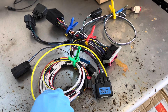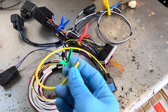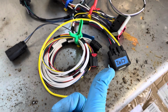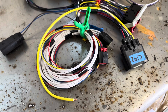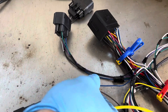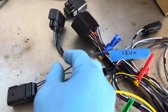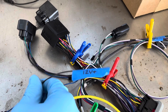You'll notice this big yellow wire — this is the starter feed to the starter solenoid. It's not a big gauge wire, just the trigger for the starter; that's the output from the starter relay on the truck. There's a one-pin connector on the truck that I just can't source — no one can come up with a good answer — so you'll have to splice that in. I'll include directions on that once this is fully released. For tow haul mode, all you need to do is give that wire 12 volts, and it goes back to the PCM through the transmission harness to tell it you're in tow haul mode.